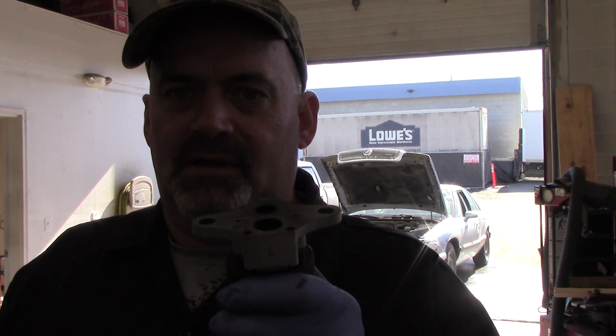But it doesn't have any contamination in it, it just broke. You know, it's one of those motorized EGRs. So I have a theory, though, and I think this had something to do with the explosion, because even on startup, we were getting exhaust straight into the upper plenum where that EGR diffuser comes in.